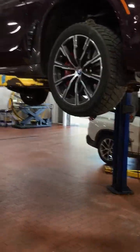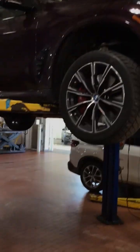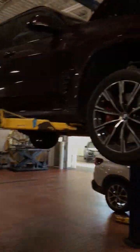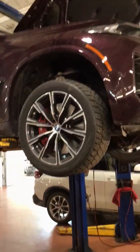So what I want to do is get those spark plugs replaced, verify our misfire diagnosis was alleviated, and make sure that the engine is running healthy again. And then I'll go out and drive the vehicle an extended duration and just see if we can replicate that transmission issue, or if it was a fault code related to the misfire of the internal combustion engine. As I said, a lot of that stuff is all tied together with modules, and systems will start to shut down when things go wrong.